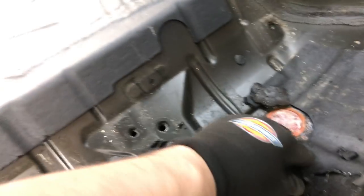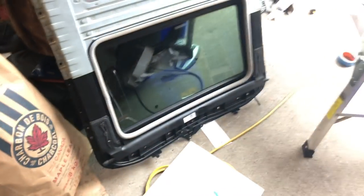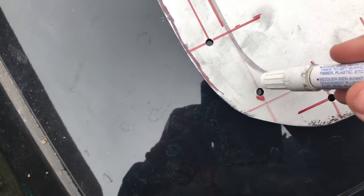After that, I removed the sunroof cassette, which is really quite a lot of weight way up high in the car, and I got to work fabricating a sunroof delete panel, which I made from some 20 gauge steel and a lot of rivets. This is actually fairly straightforward, just time consuming, especially if you rivet by hand.